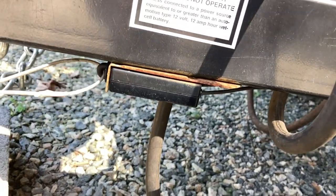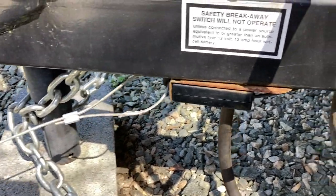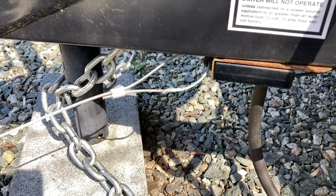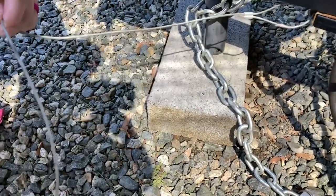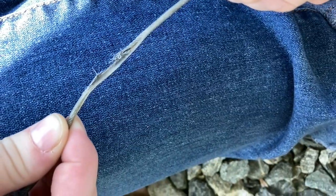There's the camper, the tongue here, and this is the emergency breakaway — if the trailer comes detached from your vehicle, it pulls the pin right there and applies the brakes on the trailer. Anybody that has a trailer knows these really long breakaway cables where you have to wrap them around the chain a few times, and after a while they can get just like this right here. You guys can see the wire is already broke — it's just hanging on by the plastic